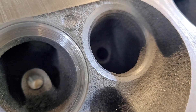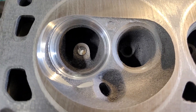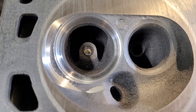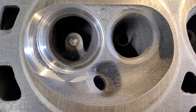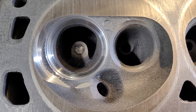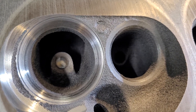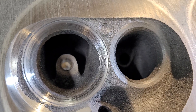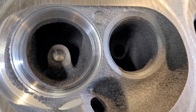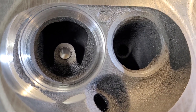I also did a plunge cut on the chamber. You can see where the old head gasket was — it comes out almost exactly to the edge of the chamber, where it should be. I measured it and it's the same as the E7s that I did for DV. I actually gave him a call tonight and told him my plan, and in his own way he said 'I don't think that's the right approach, Charlie.' I said, 'Well, I'll find out.' It's a 1.85 valve, and if it's terrible I know I can put a 194 in there with a 45 degree seat.